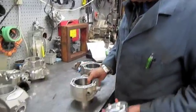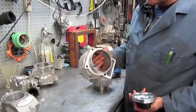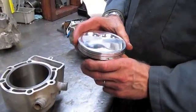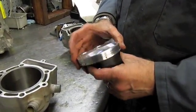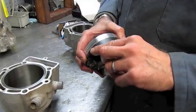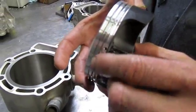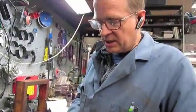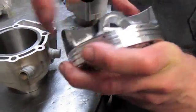Today we're also working on our 550 kit for the KTM. This is the cylinder — we've put our sleeve in it. This is a class 45 cast iron sleeve. We have a 13-to-1 compression ratio piston with valve reliefs for plus-two intake valves and plus-one exhaust valves. It's got a friction dry coat lubricant on the skirt and lateral gas ports on the ring land to help improve ring seal. The piston is made for us by CP, and one of the important features is that they have passageways drilled from the oil scraper groove to the wrist pin boss area.